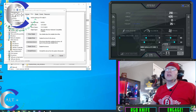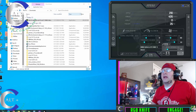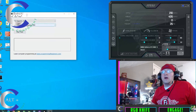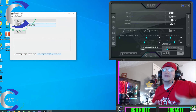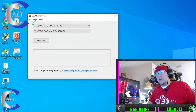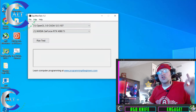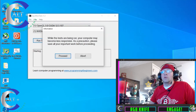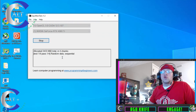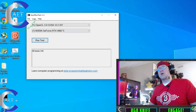Here we are in our remote session. We can see our GPU showing in device manager, and MSI Afterburner shows it with our installed drivers. The first thing I like to do is a GPU memory test. To do that, we need to make the GPU the display output first — so we switched it and relaunched GPU mem test. There it is — there's our GPU. We ran the test and, as expected, all tests were okay for the GPU mem test on our 4060 Ti.